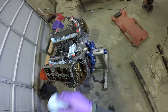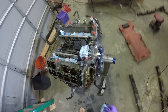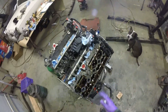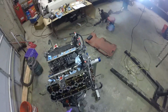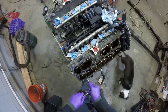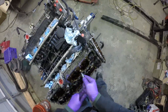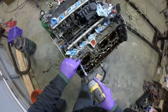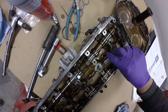Just in case, I'm also going to mark the camshafts in the upward position, because everything does have to come out. Now the only thing left to remove the cam carriers is to undo all these bolts. To remove the upper cam carrier, work outwards to inwards in a cross fashion.